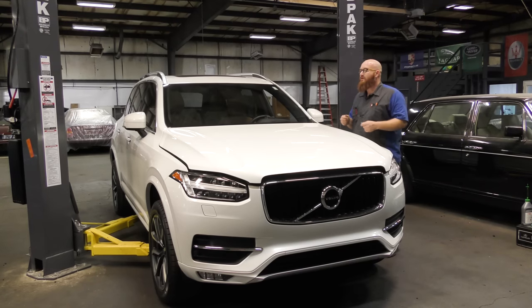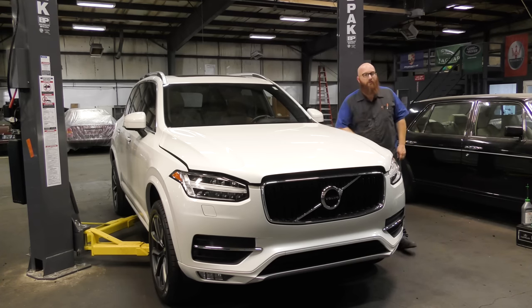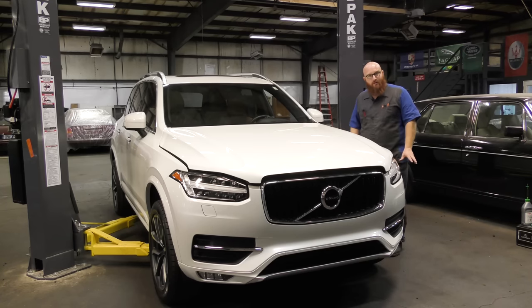As you've just seen, most modern cars — especially those with electronic shifters or a lot of electronics — don't like for you to have it in neutral and turn the key off. Some cars with fully electronic shifting, even if you have it in neutral, automatically go to park when you turn the key off. I don't really have a problem with that; it's a little more of a hassle but I've learned to deal with it. My mentor, a 30-year Chrysler master tech in his 60s, was old school and that really used to upset him — he'd throw his pliers on the ground and walk off. He felt car companies were controlling him. I just see it as technology.